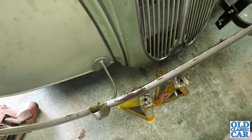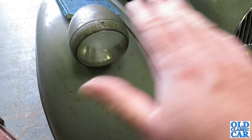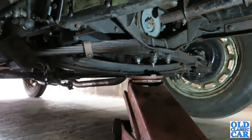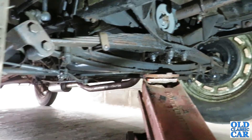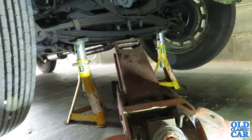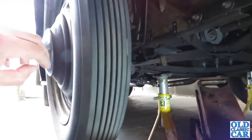The jack and the stand are dug out. I'm going to jack it up to drain it. Once it's drained, I'll drop it back on the floor so that the car's level for refilling, which you do from inside the car. It's now on the stands, so that's all good. While it's up here, I'll have a look at the kingpins and so on.